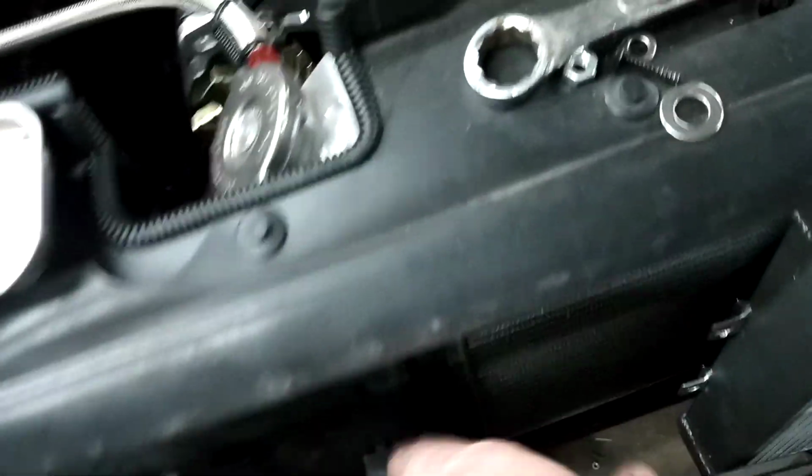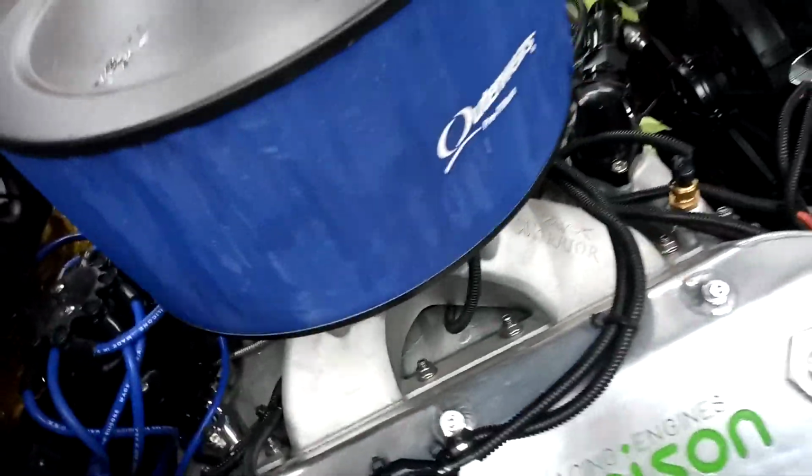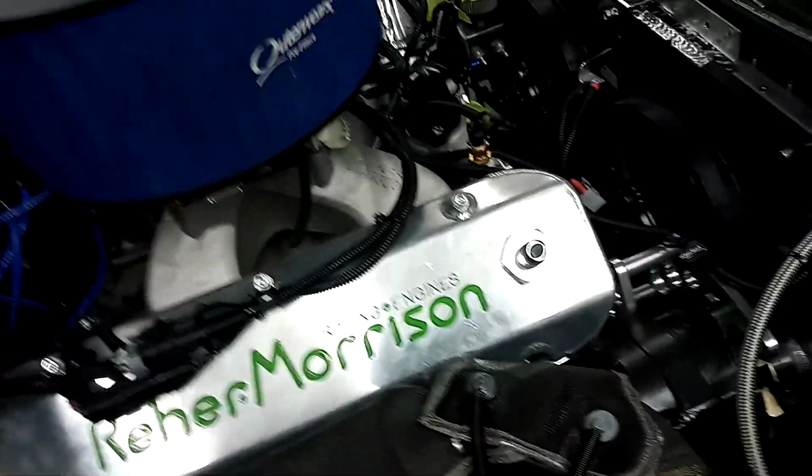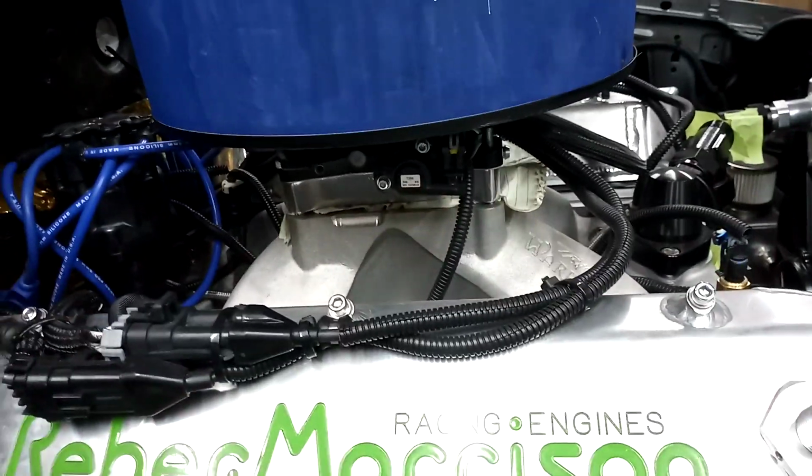Getting closer. I got the grill popped out because I've got to hook the lines on, then mount the tranny cooler because everything's just so tight. Was able to keep the catch bottle over here for the radiator. And of course the water pump wiring comes up, there's an inline fuse, and then it runs back and goes in to the switch, and there's a fuse box in there too. And then I have a dedicated fuse box just to the Super Sniper.